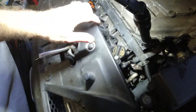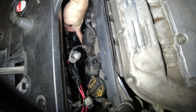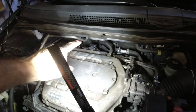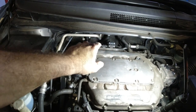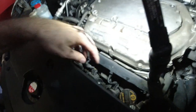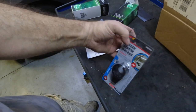Sensor ones are these top ones. So there is one right there — that's bank two, sensor one. There's one over here where you can't see in the back. I think I have to get it from underneath maybe. I'm going to lift the car up and see if I can get it from underneath, because I can't see where the wire is going. That's bank one, sensor one, and this is bank two, sensor one. So these are the two I need to take off and replace. I already took the connector off — the connector matches with the new one. Now all I have to do is just unscrew it and screw the new one in. It should be simple, right? It's a Florida car — not a lot of rust, thankfully. I'm going to try the new tool and see if this oxygen sensor wrench will get it.